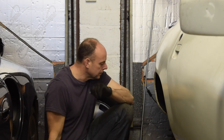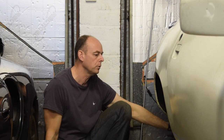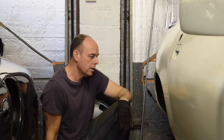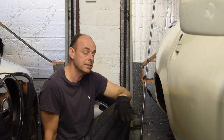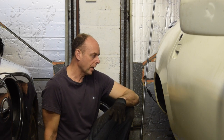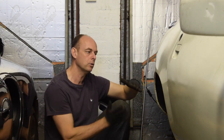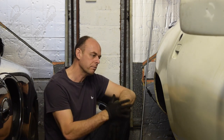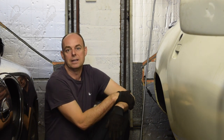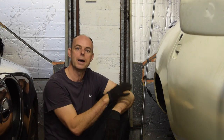After mulling it over for a few days, and after one of your comments on the last video, I think that fuel pump up there is not going to work. It's never going to be able to pull the fuel up without being primed — if it's just full of air there's nothing to pull and the pump will just spin. So I'm going to have a go at relocating the pump back down onto the cradle. To do that I need to take the cradle off and then weld the bracket back on — yes, I can use my welder again, which is probably the main reason I'm doing this. The pump will be underneath, but I'll probably have to fabricate a panel on top so it stays clean. Either way, let's get the cradle off, weld the bracket on, get it all fitted back on and see where we are.